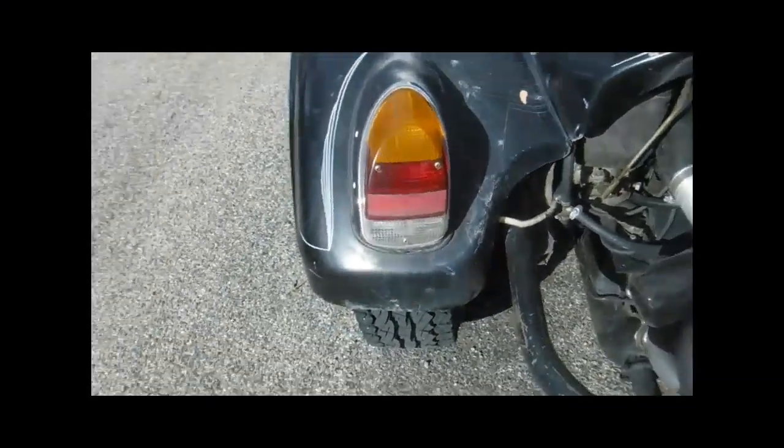You will have to clean up some of the casting in between the fins. You can do that with a hand file or a cutting disc on a grinder. Really wear a mask — you don't want to be breathing that aluminum dust. That's a big no-no. Be careful of your eyes. Be safe.